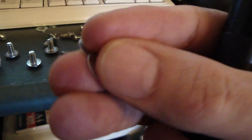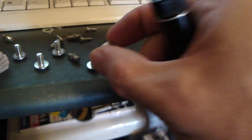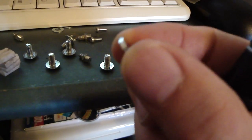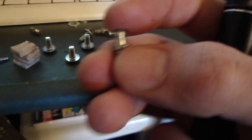If you notice on the bottom there are no more screws left, and the reason is because those screws are actually attached to the board itself, not attached to the chassis. What you'll do is push these screws through the bottom of the circuit board. Once you get these screws pushed through, you're also going to want to pick up some really small washers — get the smallest ones you can that will still fit around the screw. You only need two of them.